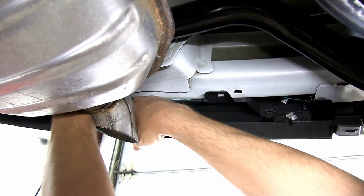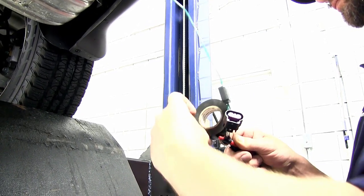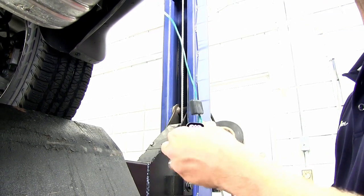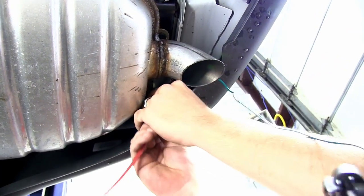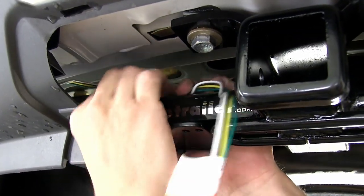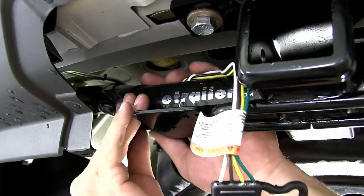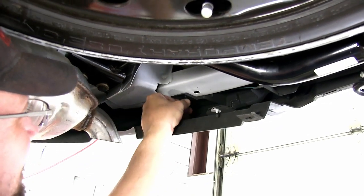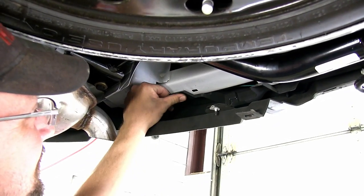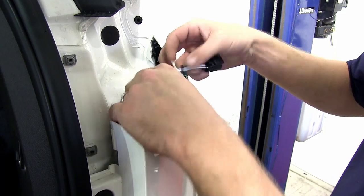Once over here, I'm going to go ahead and add a pull wire or wire leader using a piece of air tubing or wire to route it up behind the passenger side tail light assembly, just as we fed it down on the driver's side behind that assembly. Now with our wire in place, we go ahead and secure the four pole to the hitch as it routes to the center of the vehicle and reinstall our fasteners securing our green wire. With that completed, I'll move back to the passenger side tail light assembly, make connection with the manufacturer's wire and our tail light assembly, and reinstall it.